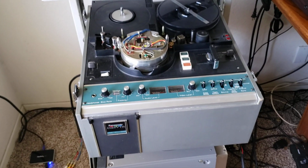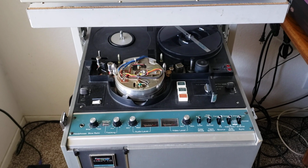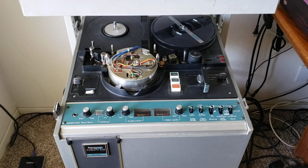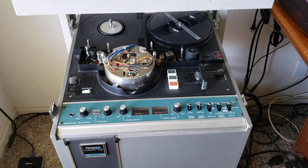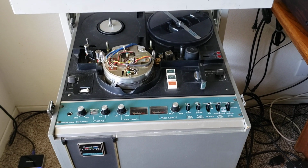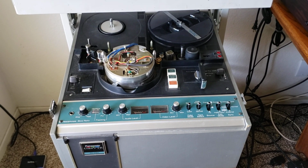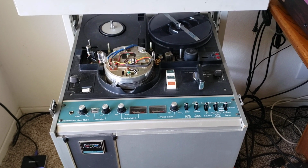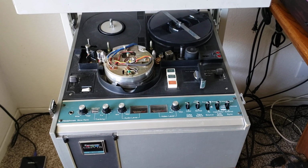Now, speaking of reel-to-reel, if you have reel-to-reel machines, you got to keep in mind, most of the reel-to-reel machines are mechanical. They take rubber tires and belts, all kinds of rubber parts on these things. They're all junk when you find these machines. I work on hundreds of these machines, so I know. So if you have reel-to-reel repairs like the Sony AV8650, Sony AV5000A, 5000, 3650, 3600, or any of the reel-to-reel Panasonic NV3130s, they all take rubber parts on the mechanical parts of them. They take big rubber tires. You can't find them. It's very hard to find the exact matches.